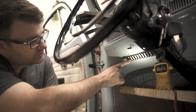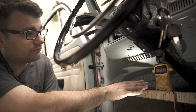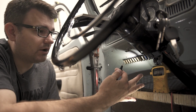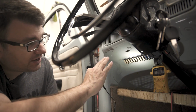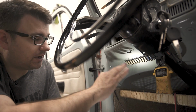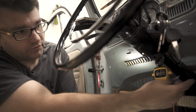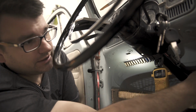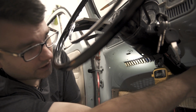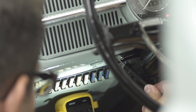Just like the blade fuse, you do have a visual inspection. Is there a connection here? And you can check them the same way with your voltage setting on your multimeter. So the first thing you're going to want to do is with your ground lead, find somewhere to ground it on the vehicle. There's a couple places you could look, but the chassis of the car or the body of the car always acts as the ground. So we have a bolt here holding up the steering column. We've got a bolt here holding up the power outlet, and actually I know that the inside of these power outlets also are the ground on the outside. For the sake of making this easy, I'm just going to hold it up against our steering column bolt.